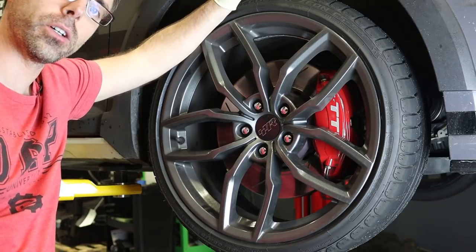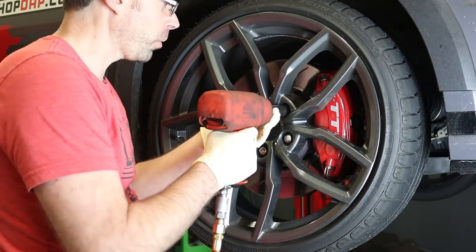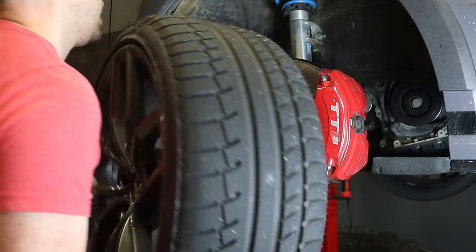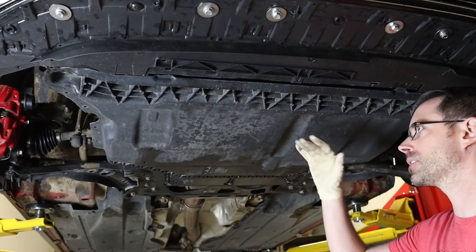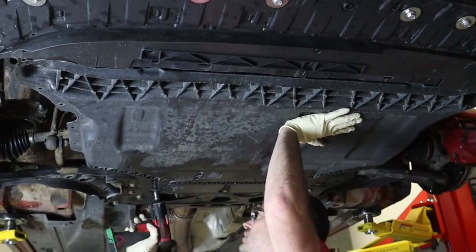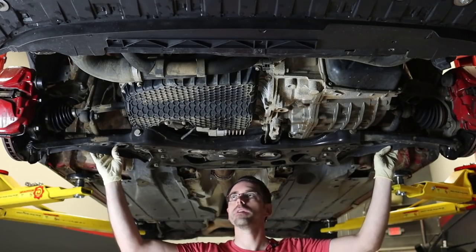To start this job you need to have your vehicle on the lift. If you're not sure how to lift your vehicle onto jack stands properly, we have a video about jacking up a Mark 7 linked in the description. We're going to start by removing both wheels and then get underneath the vehicle. We have an Alltrack so we have a full skid plate, but any other MQB car has some variation of a lower splash shield. We're going to remove this and get access to our subframe. Here are the control arms we're going to be removing.